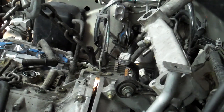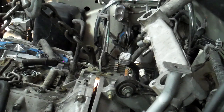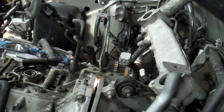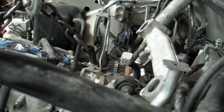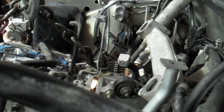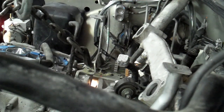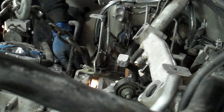As you can see looking at the motor here, there's just a little bit of a crack — just barely. I'm actually going to close that up just a little, then start to pull on it, get a little wiggle, let it down, let it separate. I'm going to rock it back and forth, pulling up on the cylinder head as I'm grabbing it, kind of pulling back and forth.